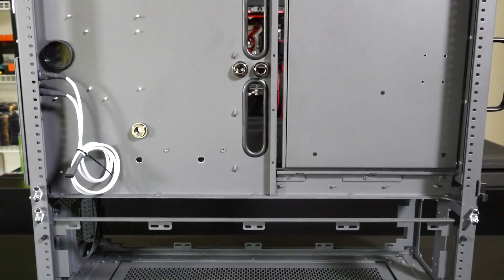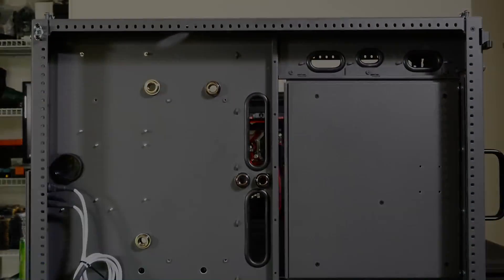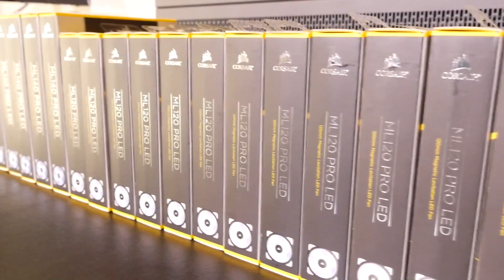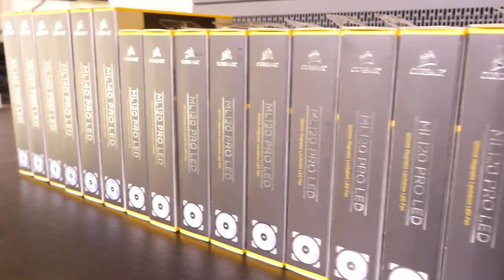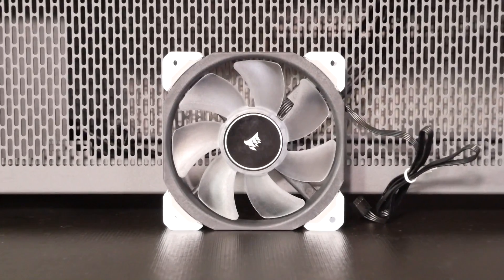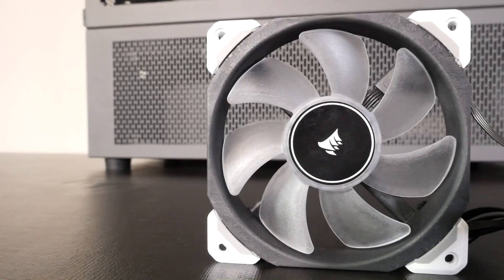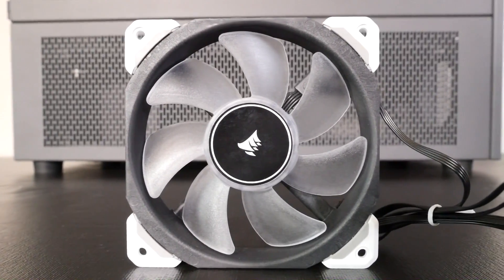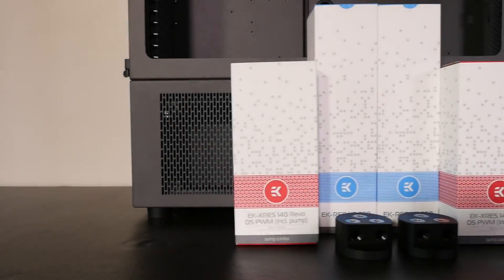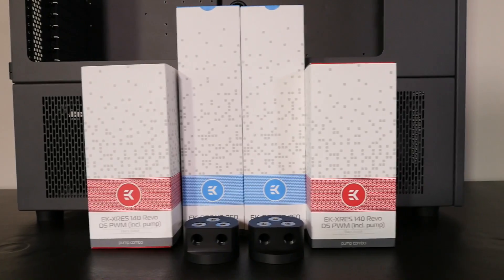You can see we've already been at this case modifying it — the case mods are actually finished now. We have a huge amount of Corsair magnetic levitation bearing fans in 120mm and also some in 140mm. One of the radiators is going to have push-pull. The 560 and 280 are just going to have a single set of fans, but the 480 is going to have two sets of fans, and there are also going to be four case fans. I'll talk about these later in the build log.